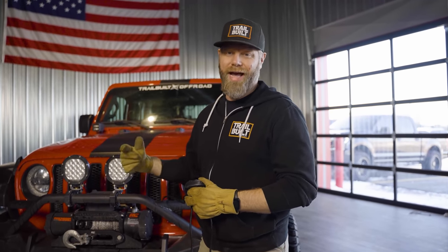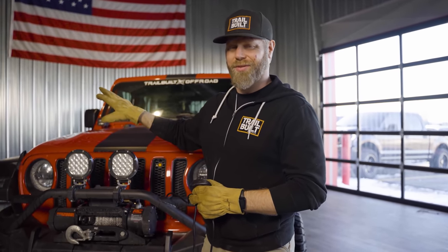Make sure the engine is running before you winch, because your winch operates off a certain amount of amperage and you want your alternator feeding the battery rather than the winch running solely off the battery. A couple of things can happen — I actually melted the battery terminals right off my battery years ago running the winch off the battery alone. You also don't want to create extra heat if you don't have to. Leave the engine running so the alternator feeds power to the battery while the winch draws from the battery.